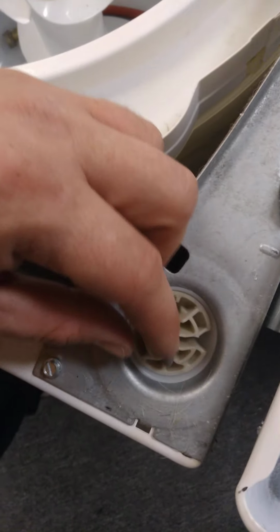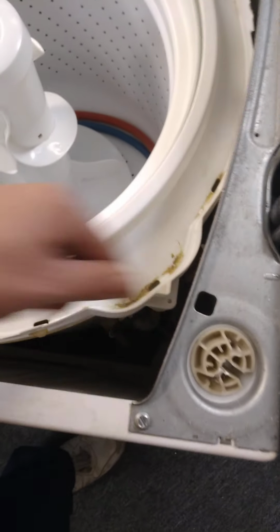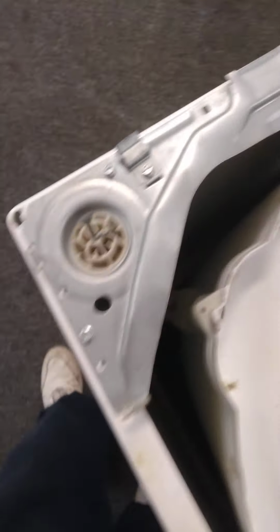So now you just leave the bottom screws in and it'll hold it. I'd leave it up against something. So to take the shock out, all you have to do is raise it up and then twist it right there where it dropped through. See how it's right there? Comes out. And it feeds in through the bottom, so I'll take them all out and then lay it on its side, pull them out, put new ones in. Pretty straightforward.